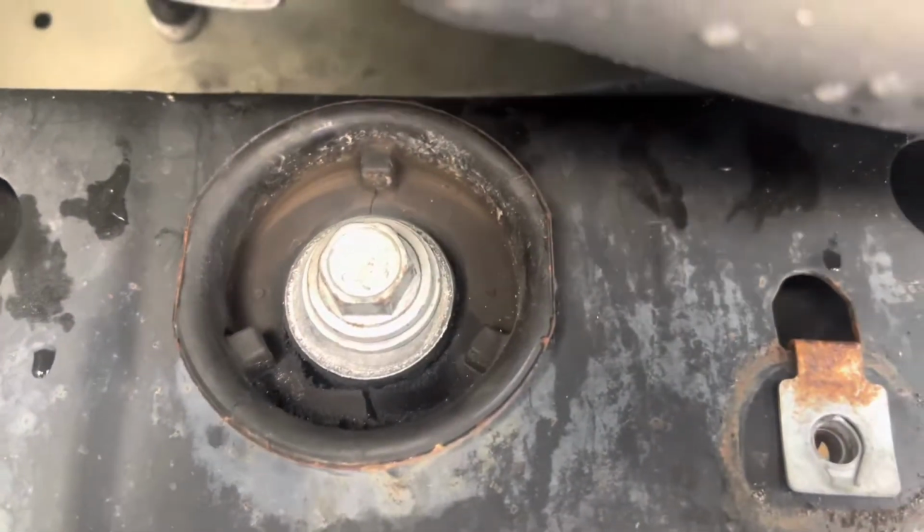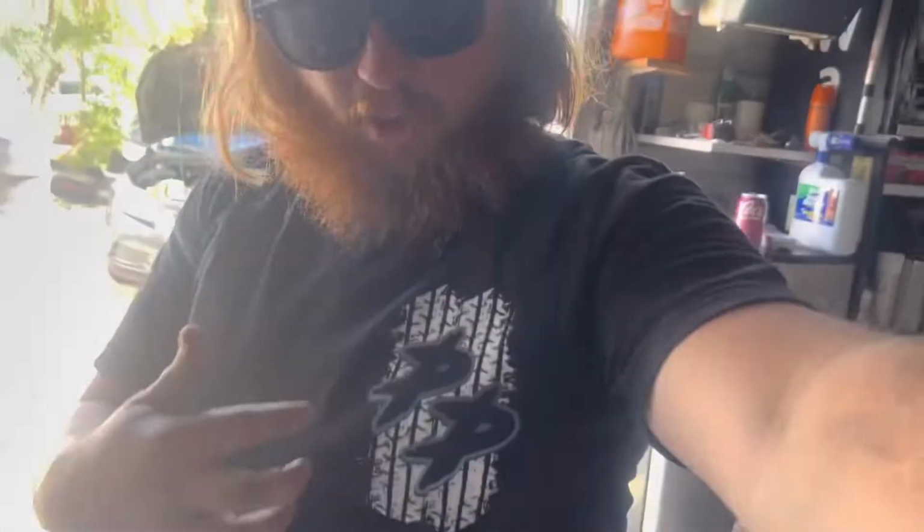We've got a bad diff bushing. It is messed up beyond all recognition, but our boys over at Parker Performance, like I said, have a BMR bushing insert kit in stock, which basically deletes the rubber bushings. Helps with wheel hop. I'm sure it's going to help this car put power to the ground. They're a little bit far away, so me and Alex are about to make the 2-hour and 20-minute journey over to their place and pick up these diff bushing inserts, and then we're gonna come back, fix this, polish it up, and be ready for OSW Black Friday.